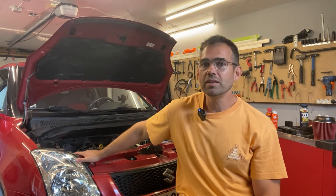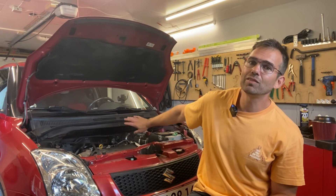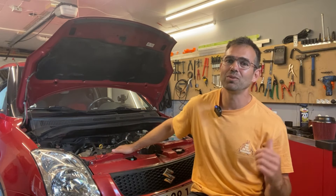So if you have this car, it's fine to buy an aftermarket filter — it will make a nice induction noise from the very first second you install it. But don't expect more power without doing a proper remap.